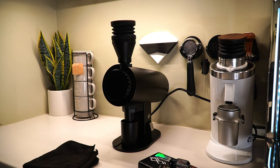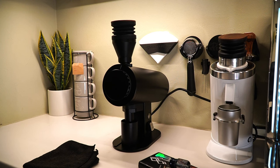So today, I want to just go through: does this have a true pre-breaker or is it an auger? I honestly don't know. I have not tried it myself. One of the things that has concerned me making this video is it does have a kind of fragile declumper. Most of the declumpers are fairly thin stainless steel. So we're going to remove that. We're going to use a set of calipers. We're going to measure the auger as well as the inner barrel of the pre-breaker, or the auger chamber. And we're just going to be as open as we can with this. So let's just get going on this.